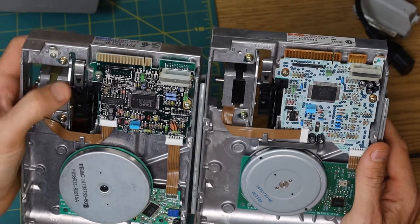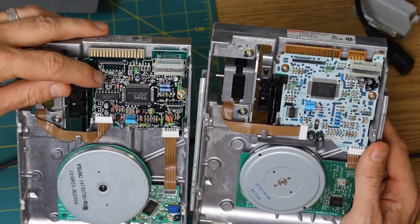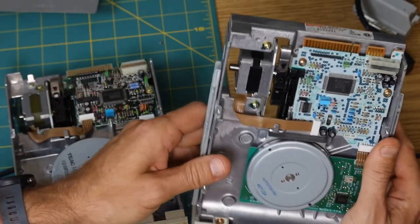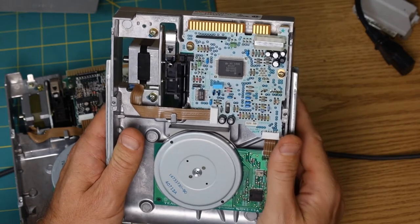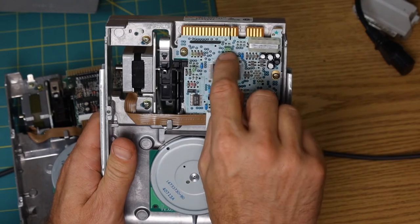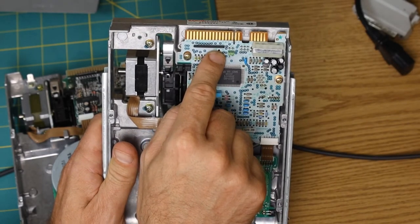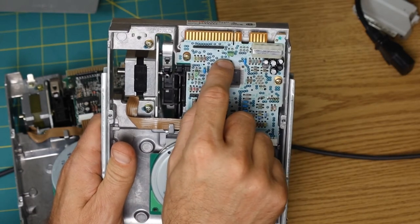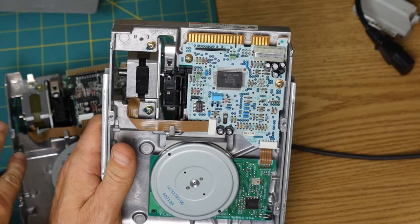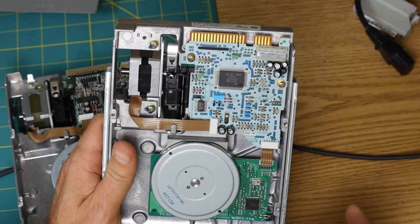Okay, so for reference, here's the 360K drive that I'm trying to get to work, and you can see that there's the missing DC pin here. Now here's a very similar flavor of the same drive, and DC is jumpered. You can barely read it on the board there, I hope. DC is jumpered, and then there's an extra pin over here for RY. So technically, if this other drive doesn't work, maybe I could re-jumper this around and put it in there.